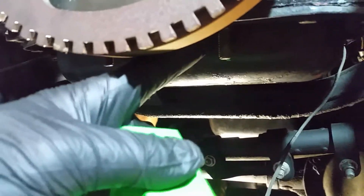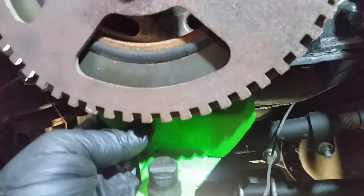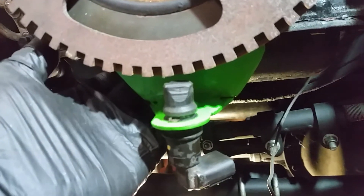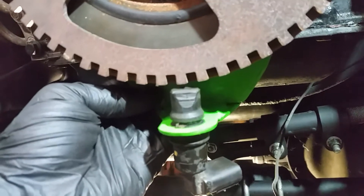To start with the basics, we've used two studs that go up into the oil pan, so we torque them down with the rest of the oil pan bolts. Then we've got a piece of angle iron that we've made so that it lines right up with that, and we drilled that all out.